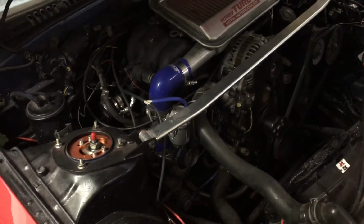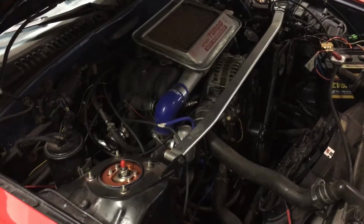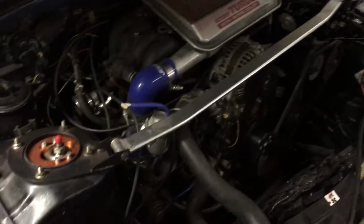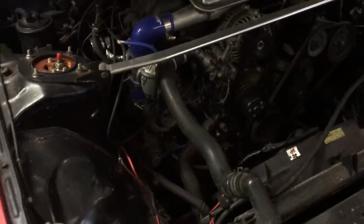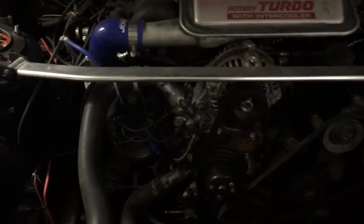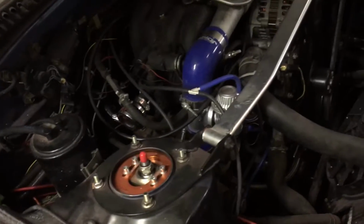And I'm running an S6 turbo. Obviously, the turbo engines only come with S6 rotors, which of course are the 9-to-1 compression rotors. Running the hardened stationary gears. I'm running an S6 alternator because it has higher amperage than the S5 ones, and air pump delete, or emissions delete. The turbo originally was a stock S5 turbo. It is now a Knightsport RF320. So it's supposed to be good for about 320 wheel horsepower.